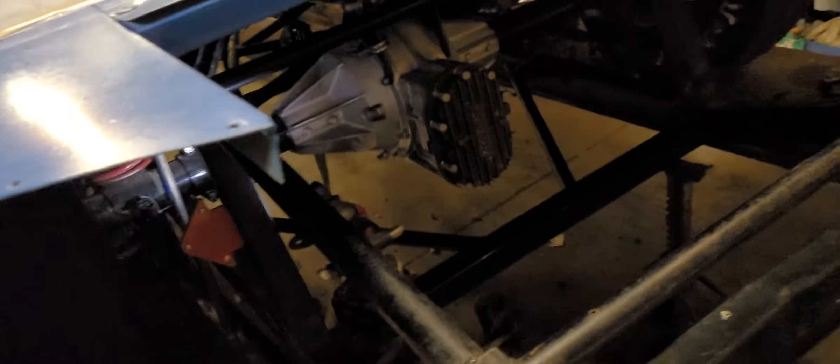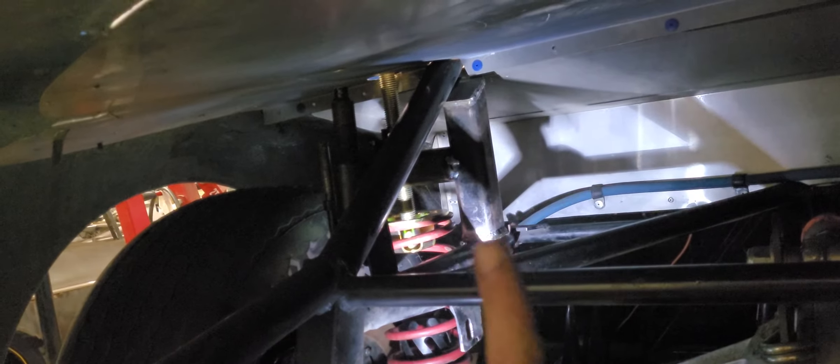See how I've got it mocked up in there? I added this brace here to go from the top to the bottom, and then brought this square tube off. This is really thick material — I'm sure I didn't need it to be that thick, but I just didn't want any problems. I didn't want to have it tear a tube or have any kind of failures. On the back side, I had to cap it off at the top because this bar and that bar are not on the same axis — they're offset. So I ran it straight with that bar and level for it to hit that bar. Then I'll just burn it in — weld it across the back, across the front, across the bottom, and finish weld everything there.